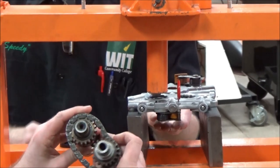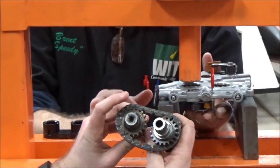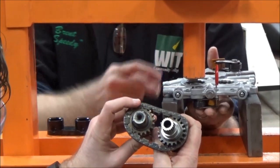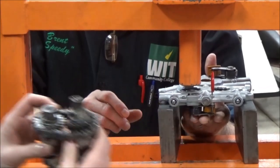What I need to do before I take it off here — and I could have done this on the bike too — is I need to take a paint marker and mark this chain so that I can go ahead and reinstall it in the correct direction. We'll do that up on the bench right now.